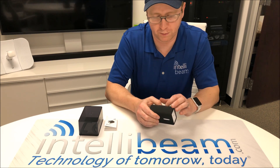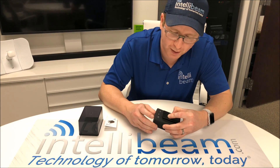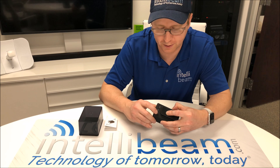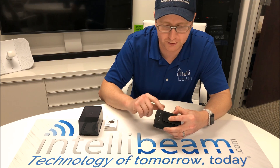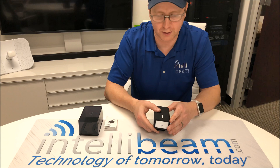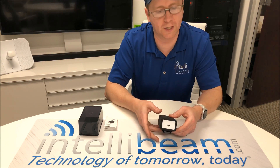They don't give you a cable for that. On the back of the device you have the reset EXT button — if you hold it down for 8 seconds, it'll default the AirMax device that's plugged into it. You have the power button to turn this on and the reset button to reset this to defaults, which is for the wireless. You can pair this with the UNMS tool available for Android and iOS.